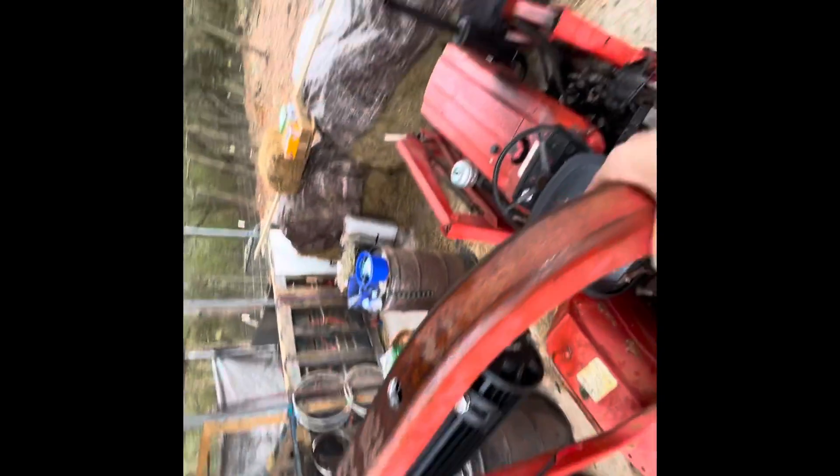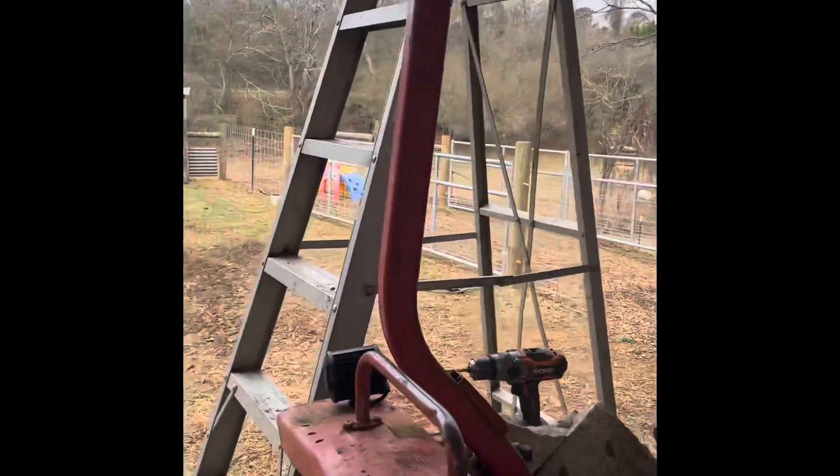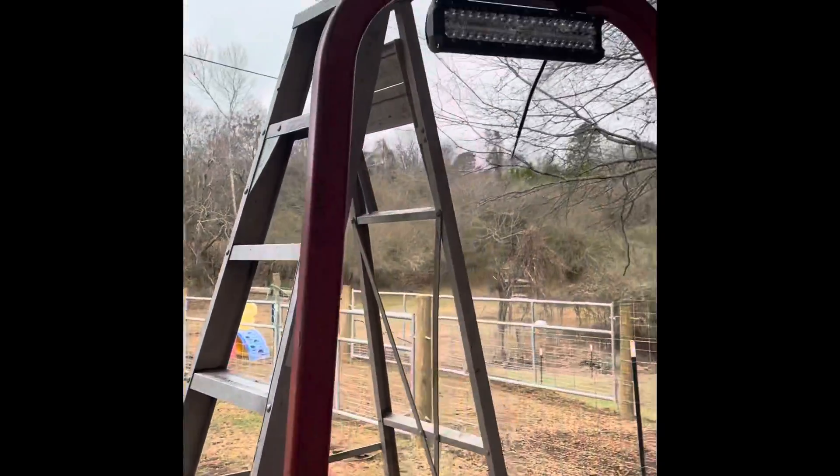Here's the bolts through the roll bar. This thing doesn't sit out in the rain, so I'm not worried about it filling with water or anything. I've got the top ones on. Now let's see where we're going to mount the pods — I'm going to put them facing backwards so I can see what's behind me whenever I'm backing up or dragging something at night. So I've got the 12-inch on top, and I mounted one pod facing backwards right here and the other one on the other fender. So I'll have some light in the back and light in the front.